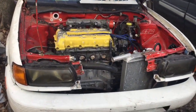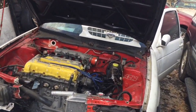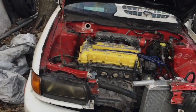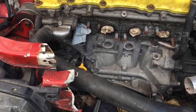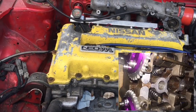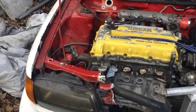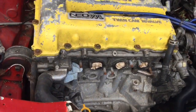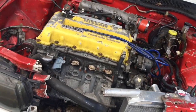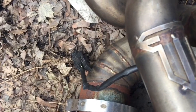The beast — Julius the B13 — looking a little rough right now, but that's alright. With a little bit of love, a little bit of force feeding, built motor. Quick rundown of the setup: it's a 2000 roller rocker block with 10-to-1 pistons, H-beam rods. The head is a P11 head, stock cam, Super Tech valve springs and retainers, stock valves, Super Tech valve seals. With the head on these blocks it bumps up about 0.8, so it's sitting at around 10.8-to-1.